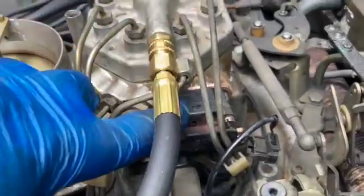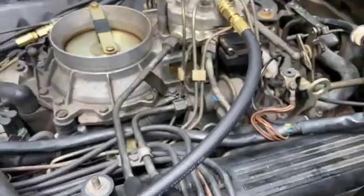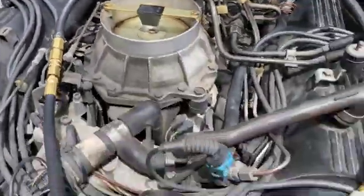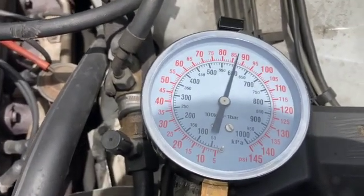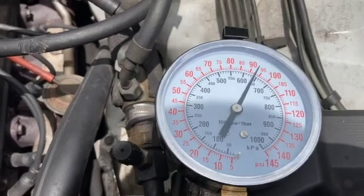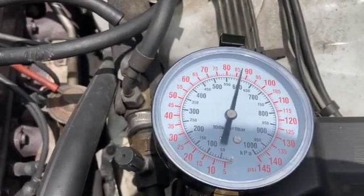Connection at your launch port — cold start port connected to this side of the gate over here. Shut off valve — the yellow one — connected to the gauge. And here you see I've roughly got 6 bar. When I open the valve, I'm at 6.4, and I'm shooting for a difference between open and closed valve of exactly 0.4 bar, and I should be right there.